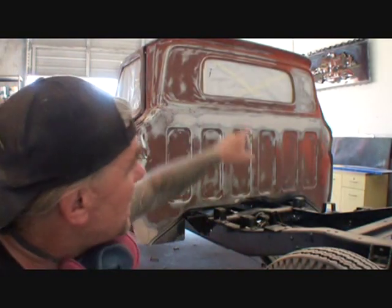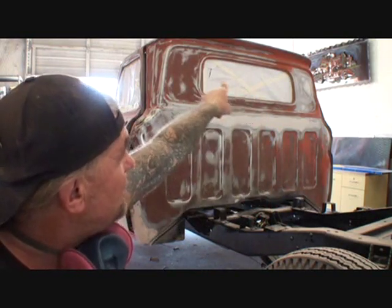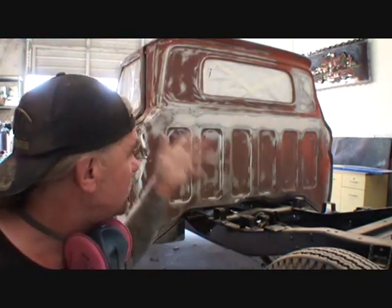The last time we saw this truck was three and a half weeks ago, and we are finally done with the bodywork. All I've got left to do is DA that section over there on that corner and up in the top here where you can see the bright orange paint. We didn't strip it down because that is the factory original paint and primer — the car has never been painted before — and the paint was in very, very good shape to block sand out and use as a base.